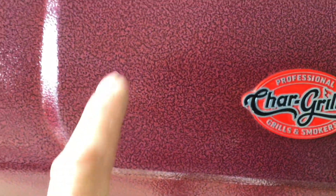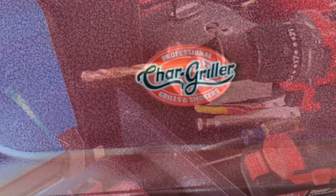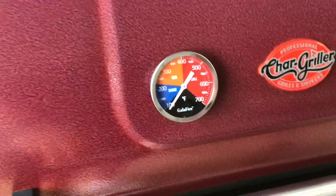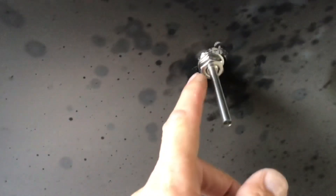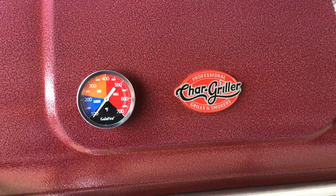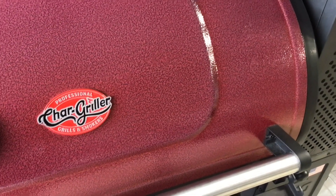At this point I've already voided my warranty, so if you're doing this too, remember you will be voiding your warranty. Using a three-eighths drill bit — one thing to remember is when you punch through, it'll probably push the metal out a little bit, but just punch it back. It is tight folks, tighter than I thought it was going to be, but you push it in and you'll get some thread on there. For the first one, I put the nut on first to bend the metal just a tad, then backed it off and added the washer — it's really good to have a washer on there.